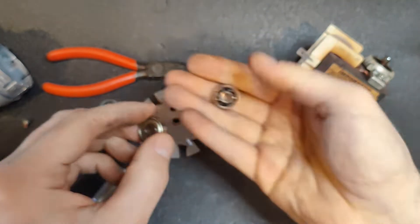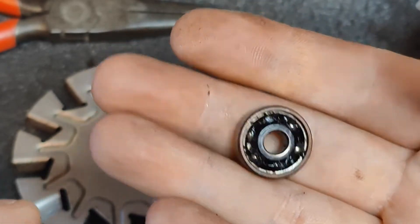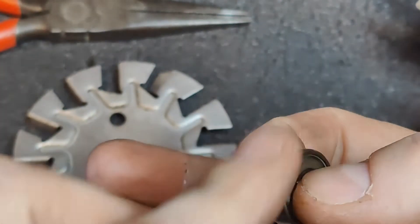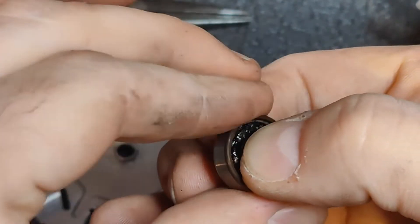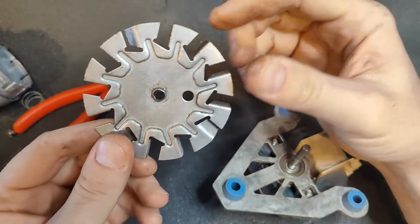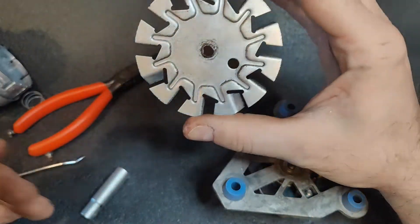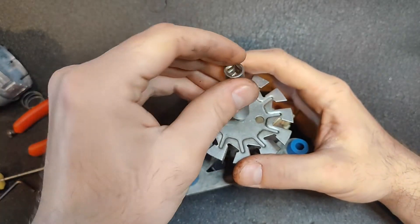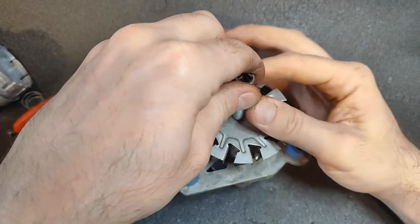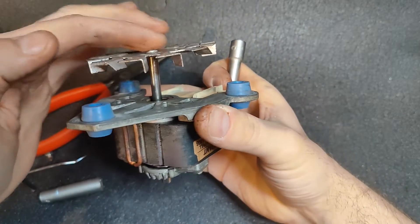I have the two old bearings here. This is the bottom one and this is the top one — the bottom one is actually still quite good, and the top one is absolutely worn out, it won't turn at all. This fan blade is held on purely with friction alone on this center shaft, and just from age it's going to loosen up. Before I put it on, I'm going to squeeze it out a little bit like that, and then as I put it on the shaft it's going to be quite tight. I'll use a socket like this to drift it down to the right height and it'll hold nice and tight.